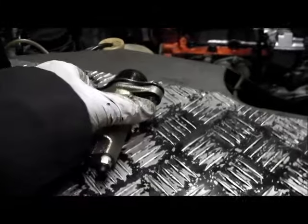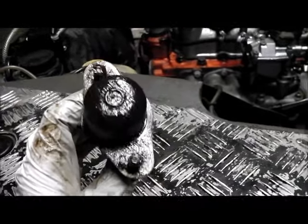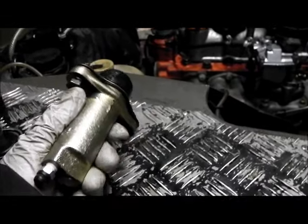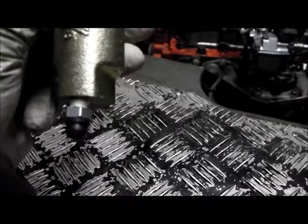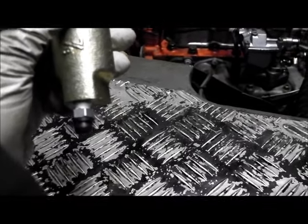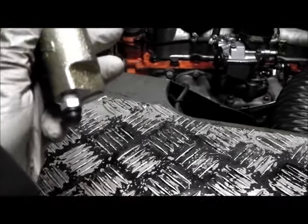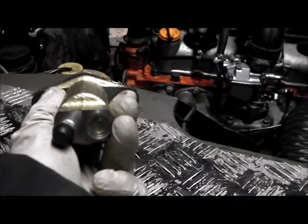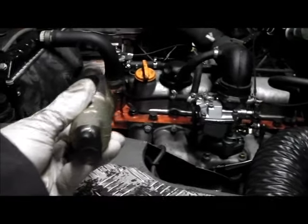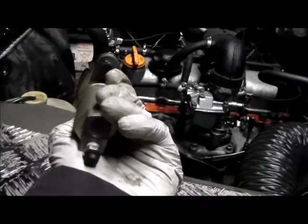Here's the new slave cylinder. The cap there is filled up with grease - not too much but enough to help keep the water out. I've greased the shim so it should come off again when I have to change it. Greased the bolts. We've PTFE taped and sealed the thread there with a bit of grease so that when we bleed it we shouldn't get any air going back through there - that's a very common problem. I'll probably take the cap off the bleed nipple before I fit it, just to make things a bit easier, but leave the bung in the threads where the hydraulic line attaches. It's also very important that it goes that way up - bleed nipple at the top - that way you get the air out.